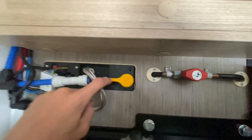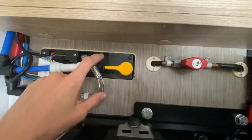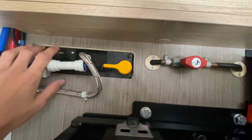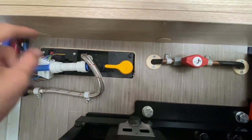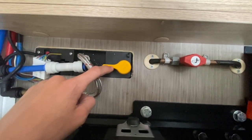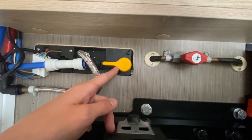It's your responsibility to ensure all water is out of the vehicle. To do so, once the vehicle is holding water, turn this tap to the back of the vehicle and leave it open. Come inside without the pump on and without the power on, and the water will cascade underneath the chassis. Leave it open when the vehicle is standing — from when you stop using it for the season or in colder climates.